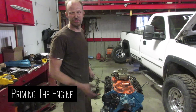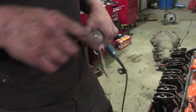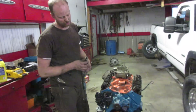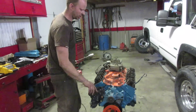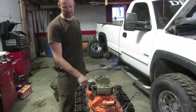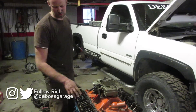We're a diesel shop, so we don't really have the right tools. What you want to do is take an old distributor, stick it in the hole, cut the top off, and put your drill on it. We just took a screwdriver and put a socket over top and cranked it over. But you won't get oil pressure to one bank because the oil pressure runs through a valley at the back, goes around your distributor, and it's the distributor that actually feeds the right-hand side.